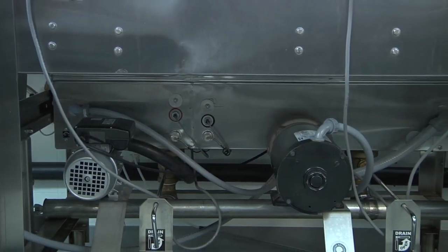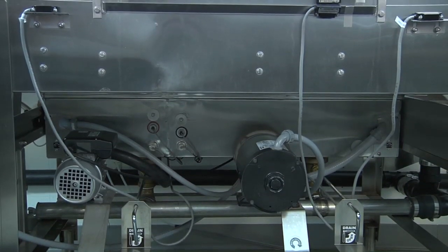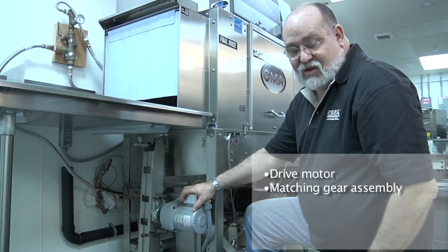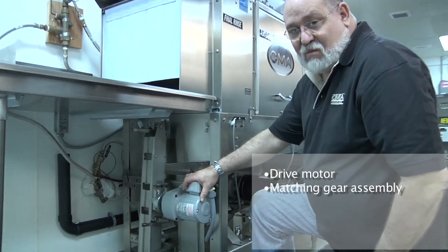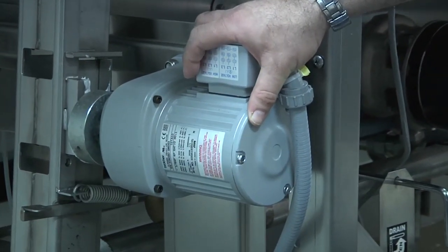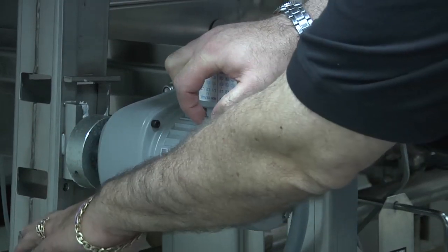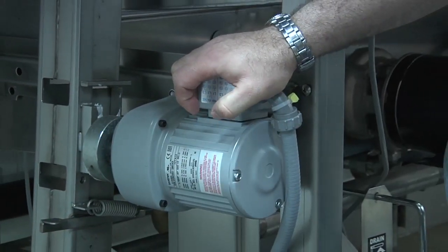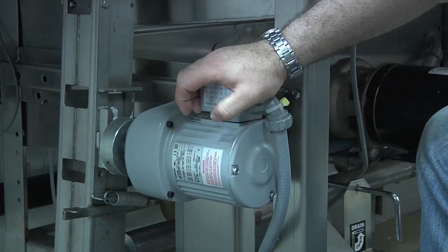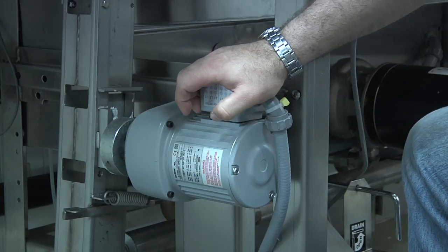Now we've completed setting the temperatures for both the wash and the power rinse tank, it's time to turn our attention to setting the temperature and pressure for the final rinse. Located at the bottom of the machine on the clean side, you'll find the new Brother Gear Drive Assembly — it is a drive motor and matching gear assembly for the new EST-44 and 66 inch conveyors. The drive assembly drives the conveyor arm and operates the spring retention clutch for the drive arm. Once the dishwasher is fully installed with water and power connected, we're now going to make the final adjustments, if necessary, to the conveyor drive.